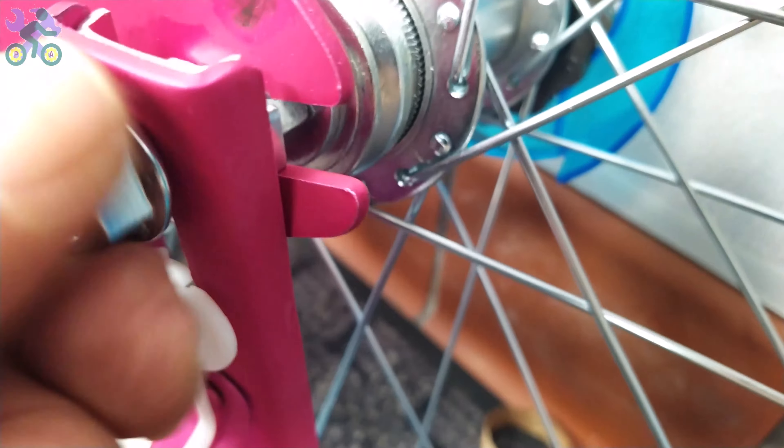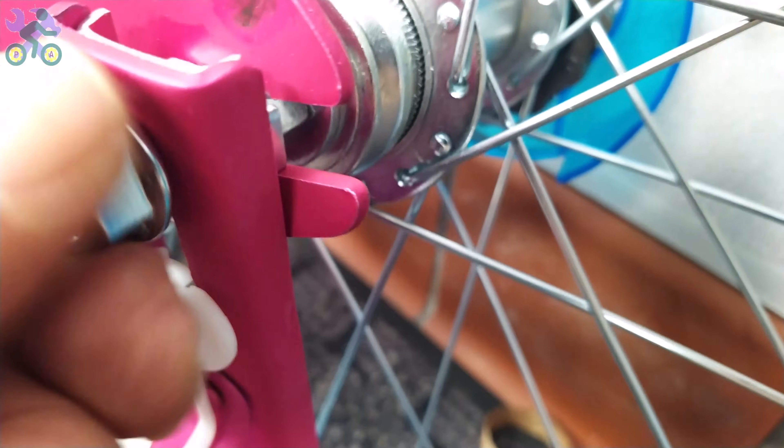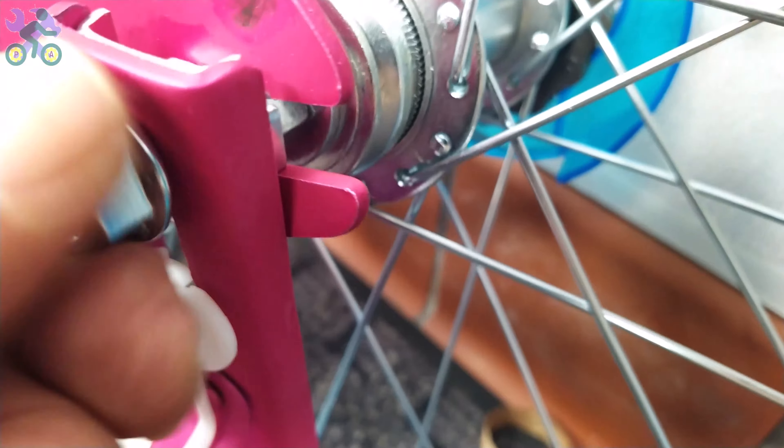You will notice that the bike is stable. There is a hole at the end of the fork — insert the wheel retainer into the hole and tighten the head nut by hand. In a few limited models, only washers are used for the wheel retainers. Repeat the same process on the other side. Now align the wheel in the center of the fork, slightly tighten the head nut on one side, then tighten the nut slightly on the other side, and finally tighten completely on each side. Don't forget to check the alignment of the wheel during the process.